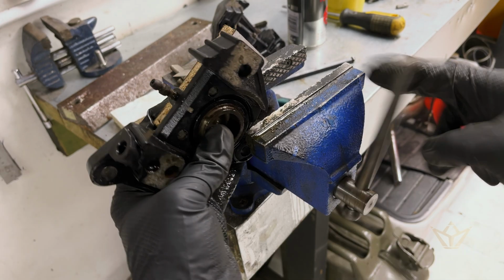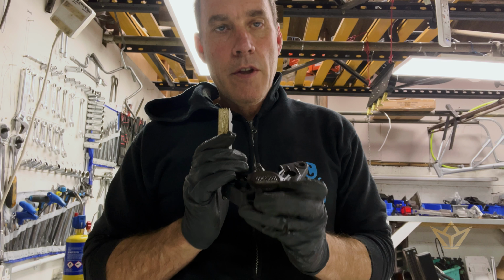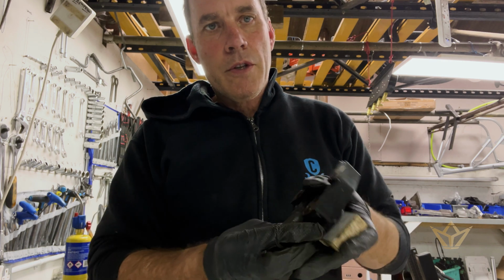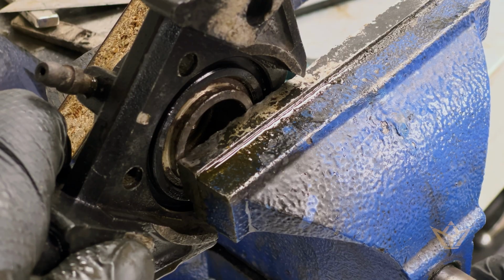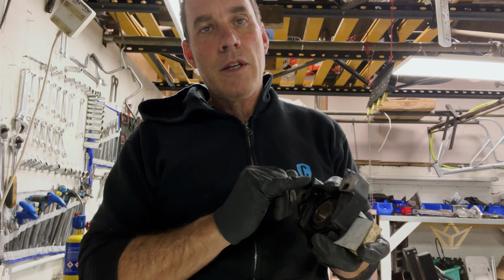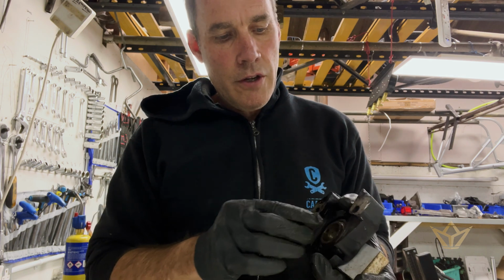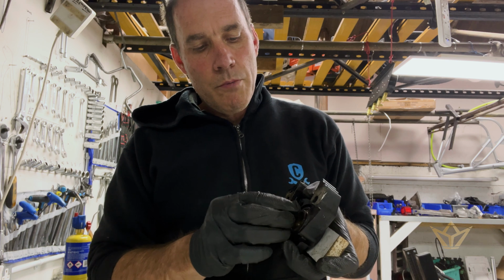and then compress it in the vise with a wooden block. Please use a wooden block. You don't want to damage the facer. You're going to stick it on there, and then on the corner of the chuck, or the jaw of the vise, you compress it. Just be careful as you compress, that stuff sprays out. It hit me in the face and I had to go and wash my face off. So it is fairly high pressure once you compress that.